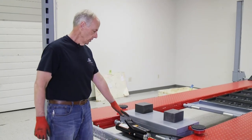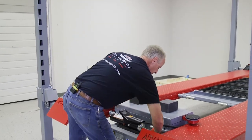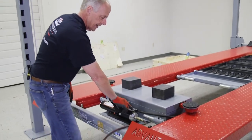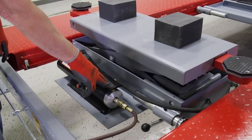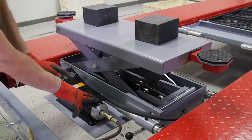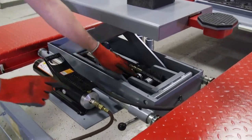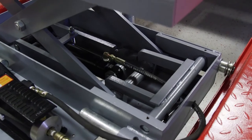Today we want to show you the air assist jack and how it operates. You'll take an air hose on the quick disconnect and pop it right on. You press on this side — that's going to make the jack operate. And as you see, it's going up. You're going to hear a locking click — you just heard it click, and you're going to hear it click again. If you look right inside here, this is your lock dog, and it's locking into the grooves in the back.